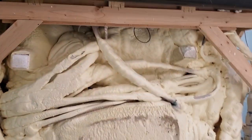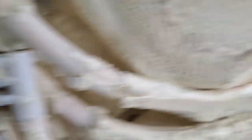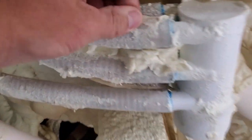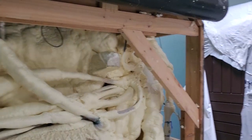Not a big deal to find the leaks — and that's always been my argument with the better quality foams. We had a leak at the filter housing and a leak on the manifold. We flipped this thing over to figure out what we could do, and there's the manifold we're going to have to address — no clamps on any of the joints. Now, in the front area they've clamped all the joints, and they've clamped the odd joint here and there. But that manifold's not clamped. I started looking at other manifolds — not clamped, not clamped. It's hit and miss. They seem to have thrown a couple of clamps here and there but they're not clamping all their joints, which they told me they were doing. And these are smooth fittings — not even the fittings with the barbs on them. So it's critical they've got to be clamped, and they told me they were clamping them.